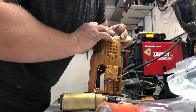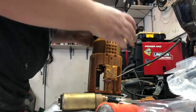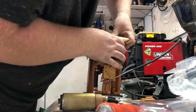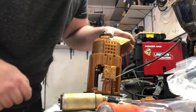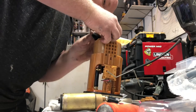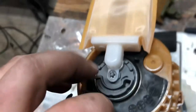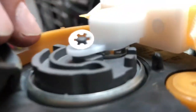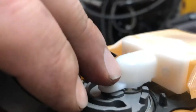We're gonna put the sock back on — it's a nice little fit, wiggle it gently. Still can't believe shops are willing to charge people that much for the extra ten minutes of work. Now I'm pushing the snap ring on. My sock is on, nice and seated, nice and flush. Then I just push on the outer edge with a screwdriver to get that ring on.